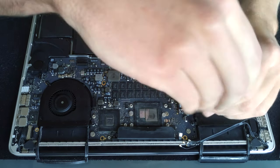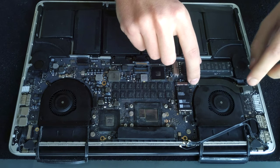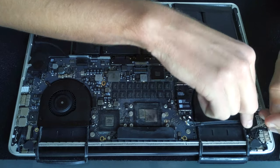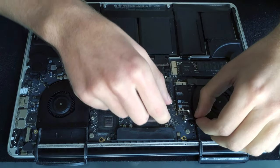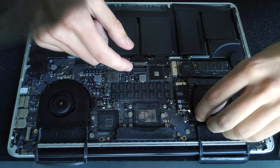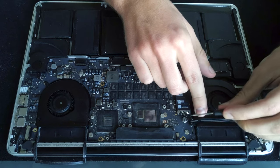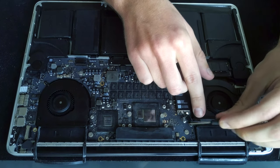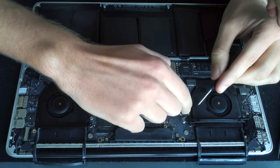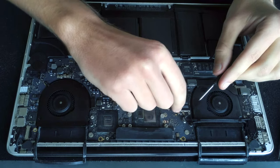One screw holds the Wi-Fi card in place as well. Don't forget about the flex power cable connecting the IO board and the logic board — just put it in so it's not in the way of the fan and it should clip in easily. Now it's time for a little cable management — the three wires from the Wi-Fi antenna go to the left and the one from the webcam goes to the right in the plastic housing. Align the webcam connector to the housing and press it in with the flat head screwdriver. The Wi-Fi antenna connectors are super fragile — make sure they are aligned with the connector perfectly before you press down.